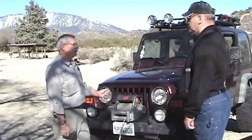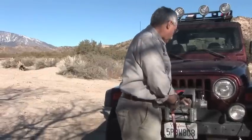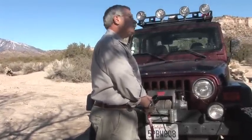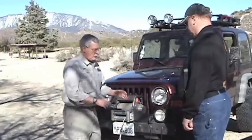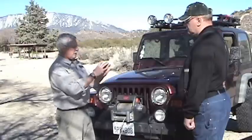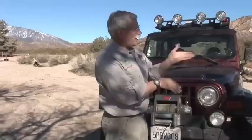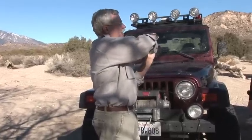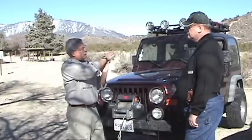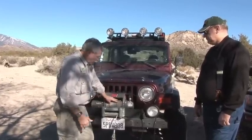The other thing on this is the brake — you can't see it, it's inside. These were designed for pulling in, but once you stop and you have a load on this, you need something to keep it there so it doesn't come out. They use an internal brake, much like drum brakes on a car, just not as big. Visualize a drum about this big around; on the inside are two or three brake linings at an angle, beveled like this. As you're winding in they're sliding over it, but once you stop, that brake comes on and stops the drum from going forward — almost wedges it. It's just friction.